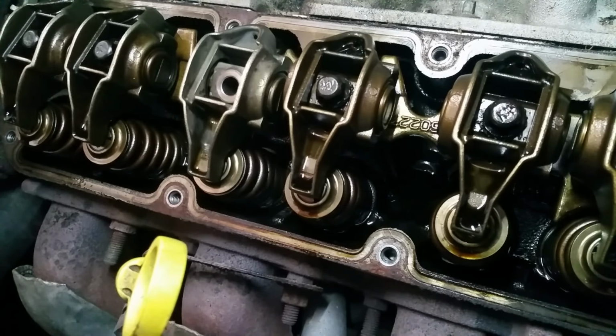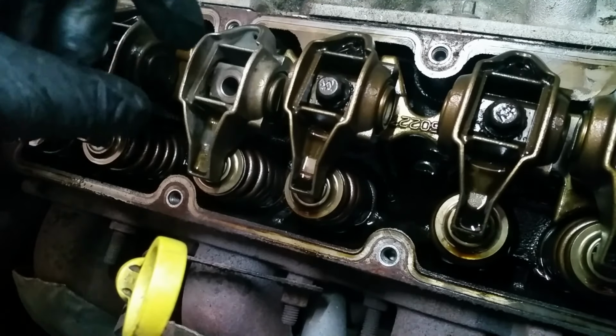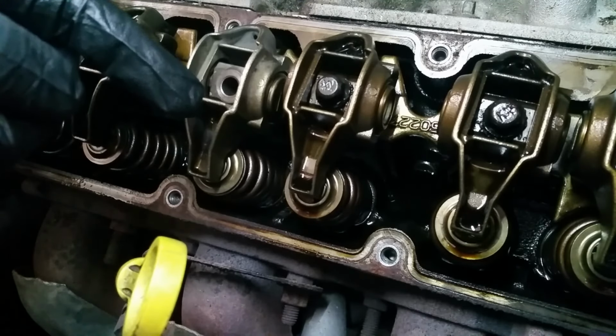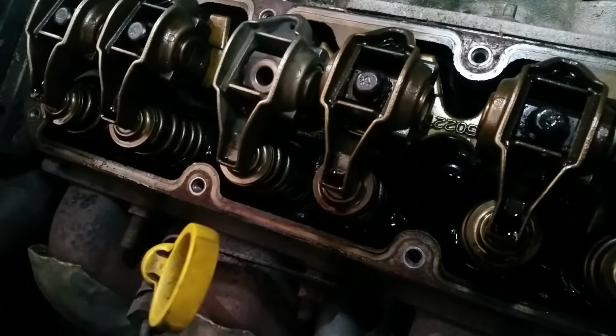We just tighten them down to the torque spec, which I think was 25 foot-pounds. I'm going to put some Loctite on it, and we should be good. After that, though, what I like to do, and I'll do this when I'm done with the whole bank here, is I like to pour oil all over all of these